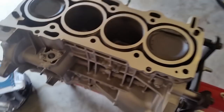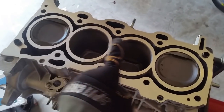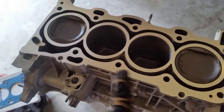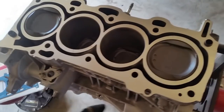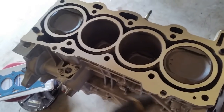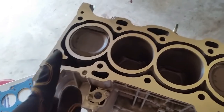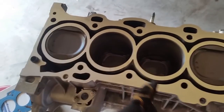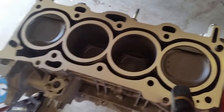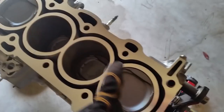At this time, I'm going to clean the surface area, make sure it's completely free of oil. I'm gonna hit it with some brake clean on a shop rag. I'm not gonna spray it directly. So you want to spray your shop rag or shop towel with brake clean and pat it. Do not scrub it, because pieces will go inside into different areas. But you want to pat it, absorb all the oil and everything, keep it on the bare metal everywhere as much as you can.